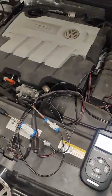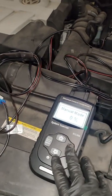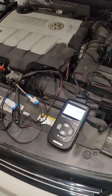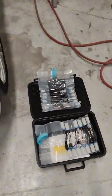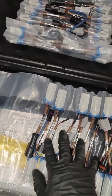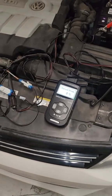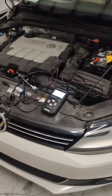This makes it a lot easier to diagnose these compressor issues when you've got pulse width modulation and all these other electrical control valves involved. You don't want to make a bad call and just condemn a compressor, so it's definitely good to have one of these tools to make it a little bit simpler. It also comes with all the connectors that you need for most standard vehicles — you just pop them on, insert the tool in between the connector and the compressor itself, and you've got full control to diagnose that compressor. Definitely check this out if you do a lot of AC work. It's a very valuable tool.